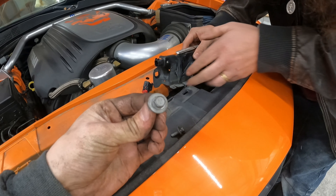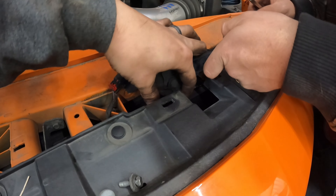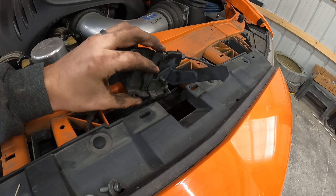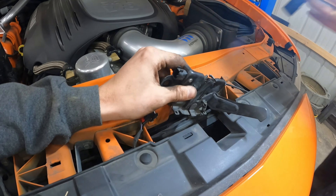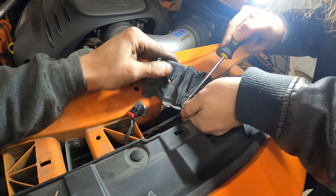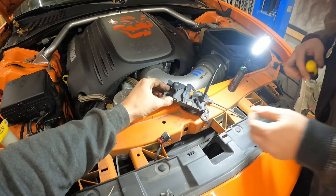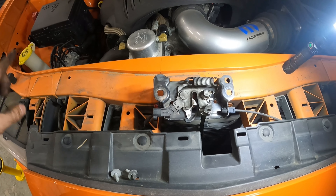All right, we got both bolts out — two 10 millimeter. We used a deep socket, but honestly a non-deep socket might give a little more room. There's a wire that's zip tied to the bottom of the latch, but that clip should pop off. Using a flashlight so we can see a little better — pointed up, we can see a little clip here that should pop off with a flathead. Once I have this up top, I'll line it up and set the cable so I can do everything properly. Now I'll grab the new part and set them side by side — I'm going to flip it upside down and pretty much swap the cable right over to the other one.